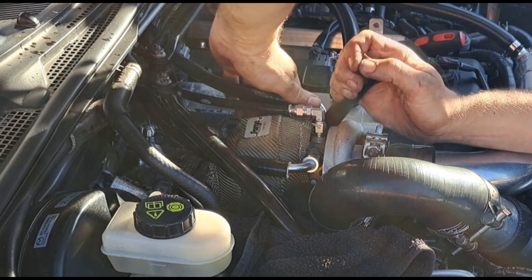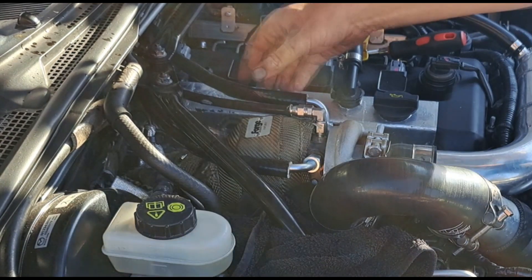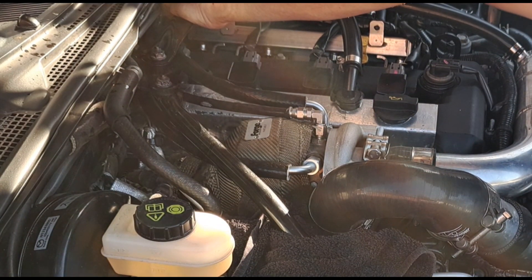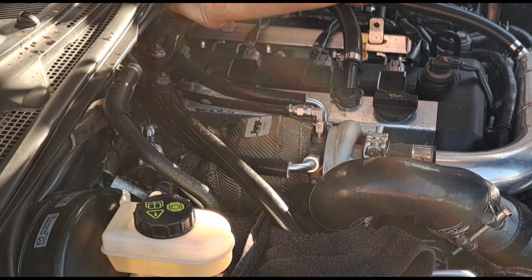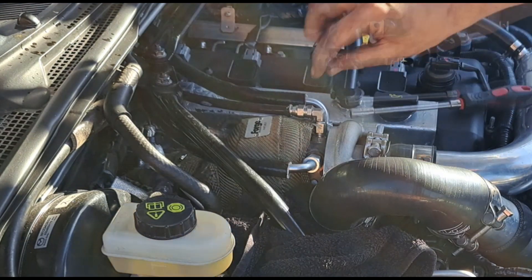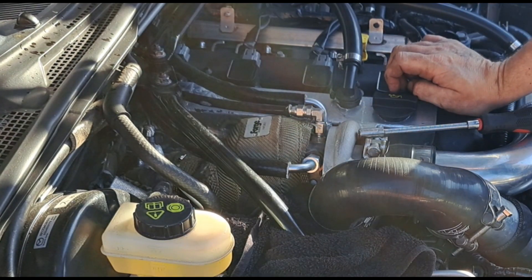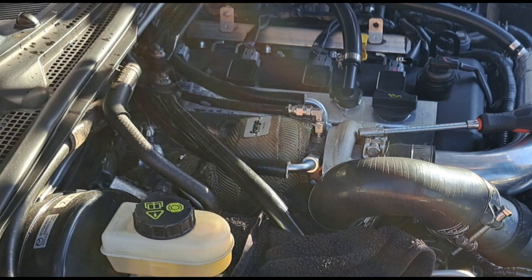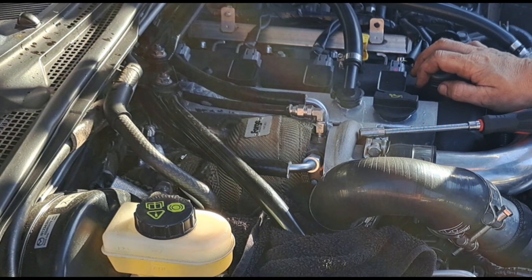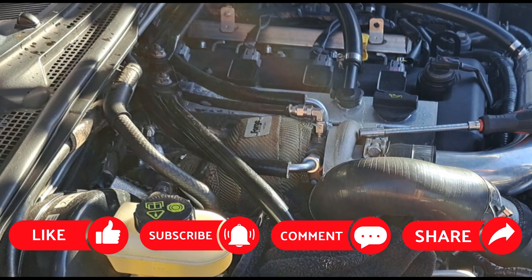Very hard to get to - probably just got it with my arm. So that's there and it all seems to be fitting nicely. Let's remember to do this hose clip up. So we were having those leaky ones beforehand, but now I've got solid metal here - nothing to perish, nothing to leak. Then it's joined at the back into my heater matrix, and this is just a new section here. Looks like it's gone really well, looks quite smart. Probably this color and the heat, but yeah, looks good.